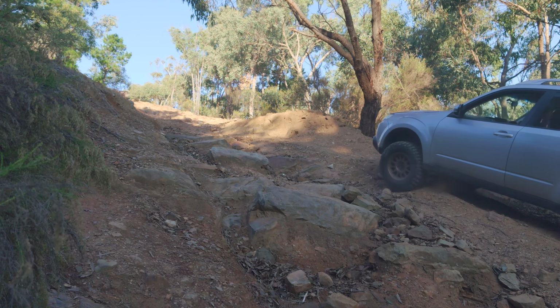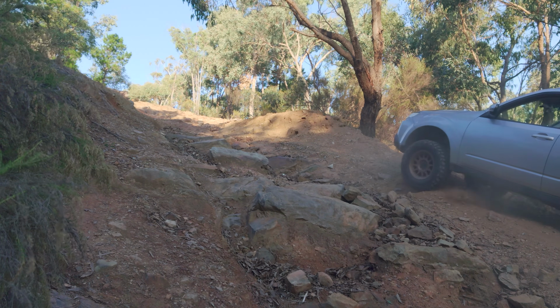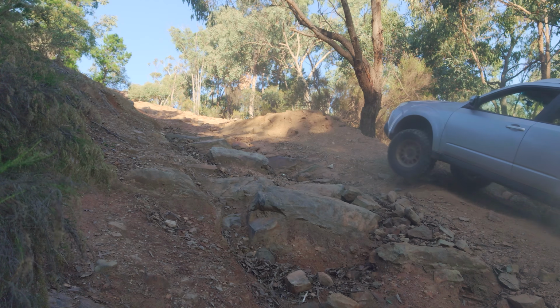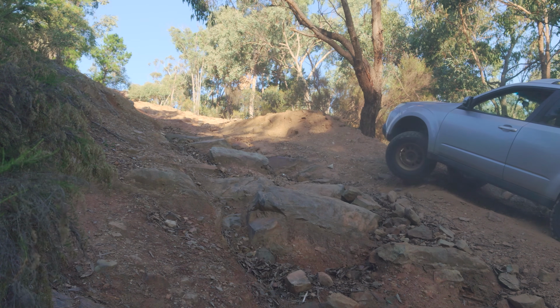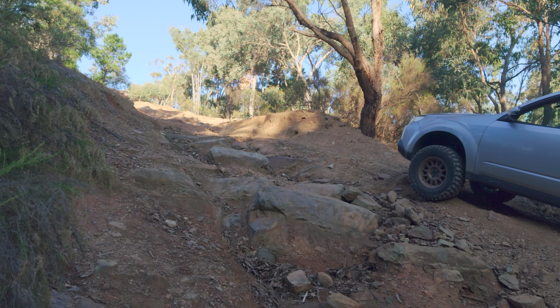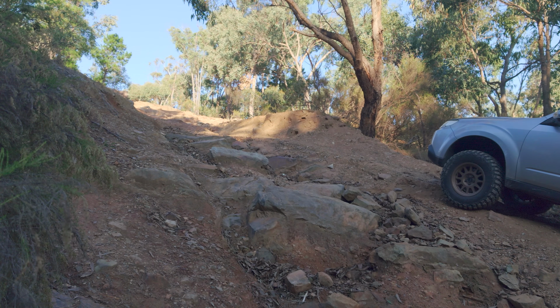Yeah, I think having some little thermo fans and some water spray would go a long way, or changing to a front mount intercooler, and it would make a big difference because the turbo really struggles to compress the really hot air. Like, it's so hot you can barely touch the intercooler after it's been sitting there for a while, after you've been off-road for a good stint. But yeah, it's something to remedy down the track at some stage.